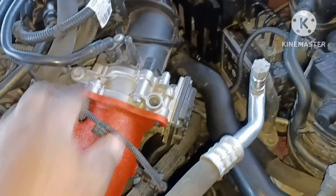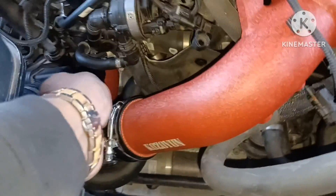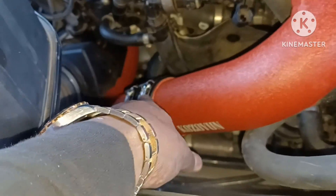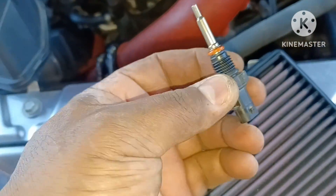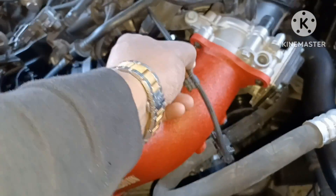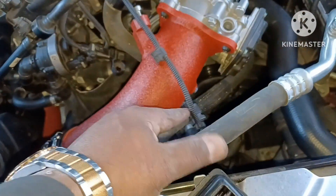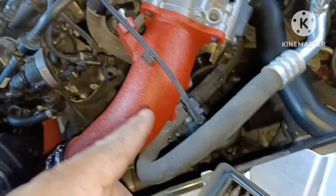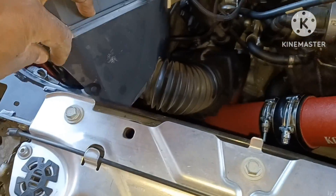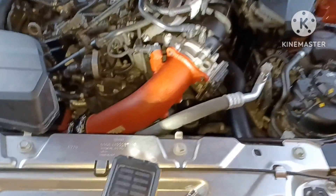The charge pipe is locked onto the intake. Make sure it's nice and secure all around — I haven't tightened the top yet because you need to get it out far enough to adjust and pull it up. It's locked in at the bottom and locked here. I've got to do my sensors. Don't forget the sensor that screws in on the bottom. This is going to be kind of hard because there's not enough wire slack to get it up under here — I might have to take it out of the harness and run it around to drop it up under there. Don't stretch those thin wires. I'll pop it out of the harness and run it around — that'll be fine.